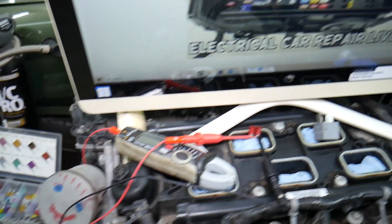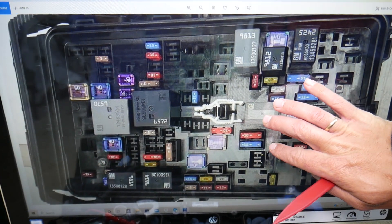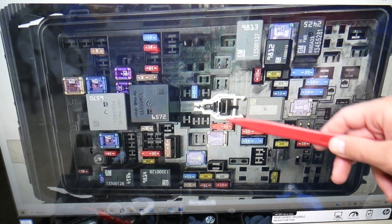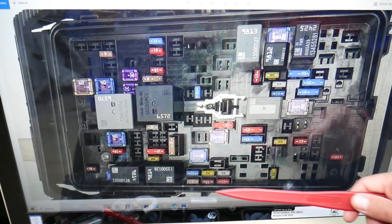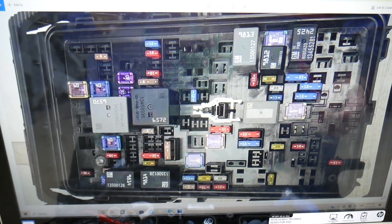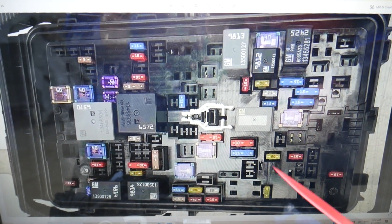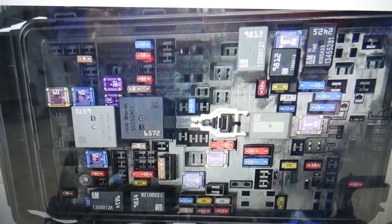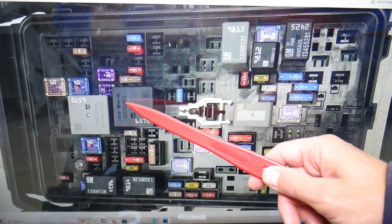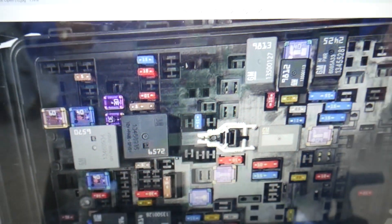Now, the ignition relay — you have five to six different kinds of fuses and six or seven different kinds of relays in this fuse box. Those can be hard to find or expensive to buy in the middle of nowhere, so we'll put a link in the description where you can get them at a good price with quick shipping — always keep some in the glove box for peace of mind. The relay for the ignition switch that you need to check is known as relay number 31 — that big relay right here.